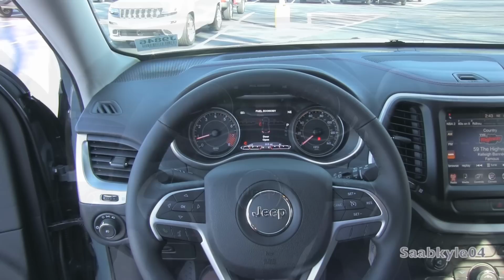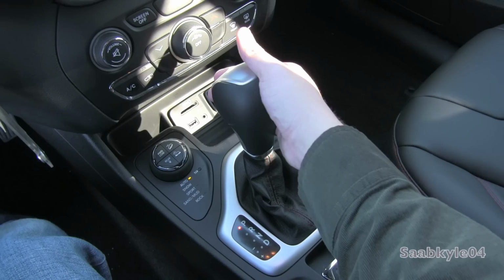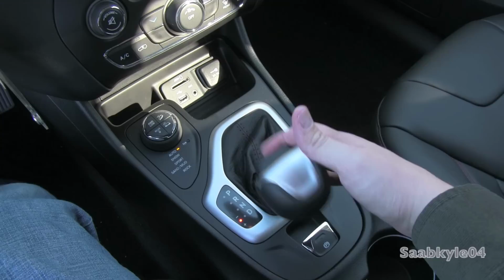As far as the gearbox, an all-new 9-speed ZF automatic transmission is the sole option available. The transaxle features a wide 9.8-to-1 ratio spread for peppy off-the-line acceleration without sacrificing highway fuel mileage. It also makes gear changes nearly seamless and actually increases fuel economy by 10% compared to a 6-speed auto.